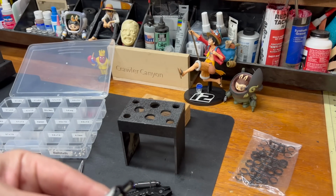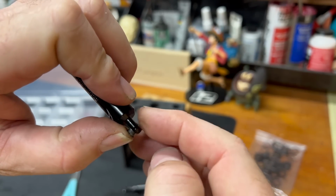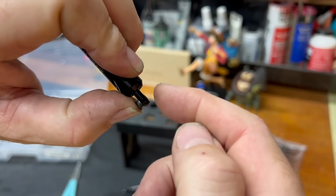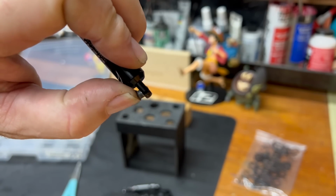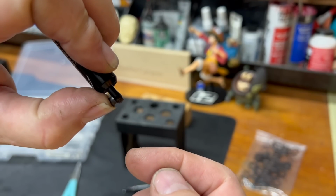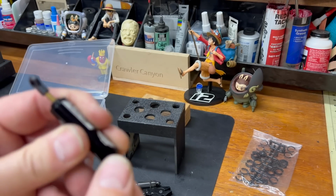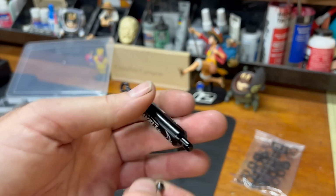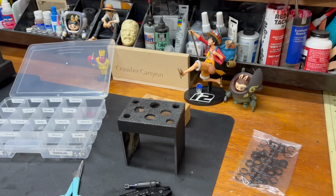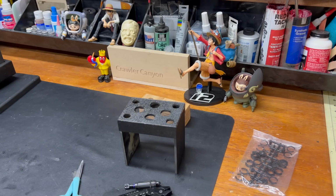So it can give you issues mounting them upside down on some vehicles, because they tend to run a flathead screw to give it some room to pivot. You can get away with a washer on that side sometimes, or a little small spacer. But there are some rigs where it's more difficult to get these mounted upside down than right side up. So I definitely recommend, if you're fitting Desert Lizards to your rig and you intend to run them upside down, which is the way I recommend, make sure that you can do so.